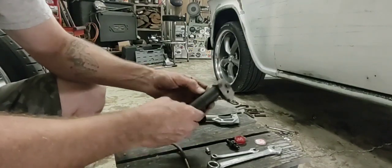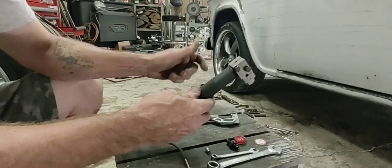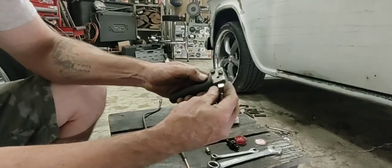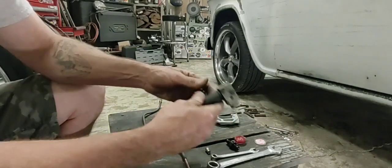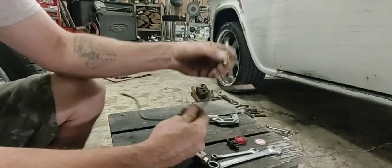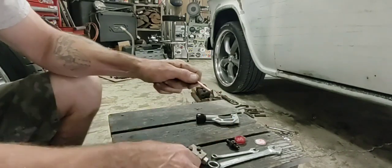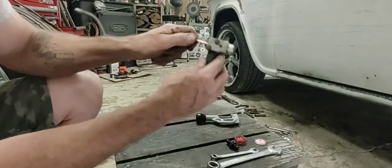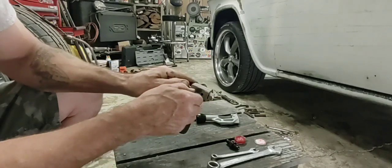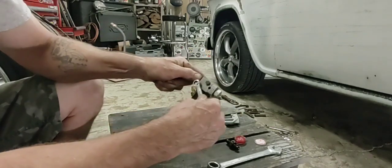Here's that flaring tool from Speedway, 3/16ths. Pretty simple, it's a great little tool. It comes with this piece here - you put that in first, finger tight. Then you take your brake line - got my gravel guard on there, don't forget to put your flaring nut on there first. Slide it in that hole, bottom it out against that nut, hold some pressure on it, grab your wrench and tighten them up evenly.